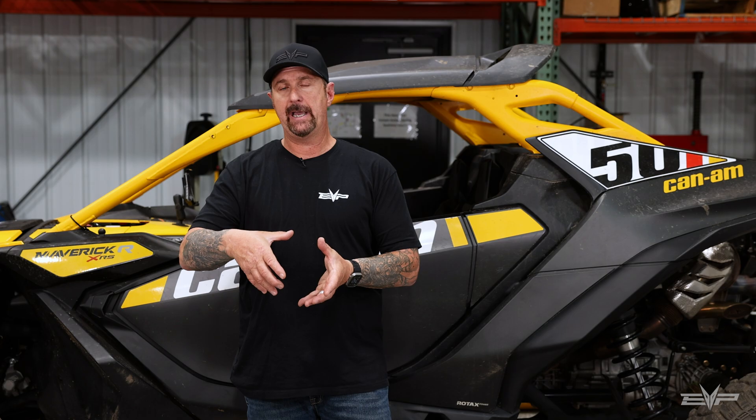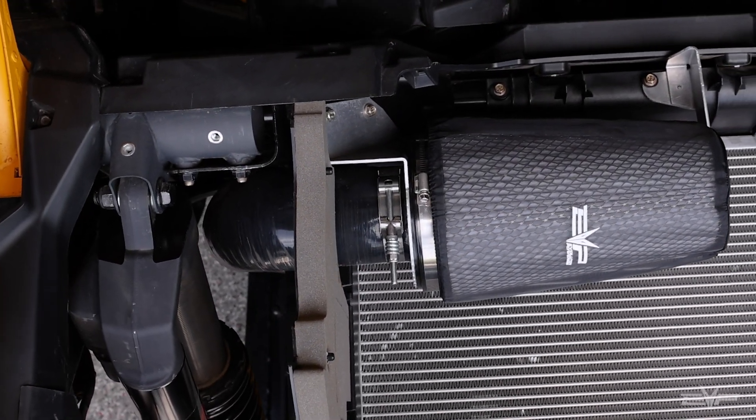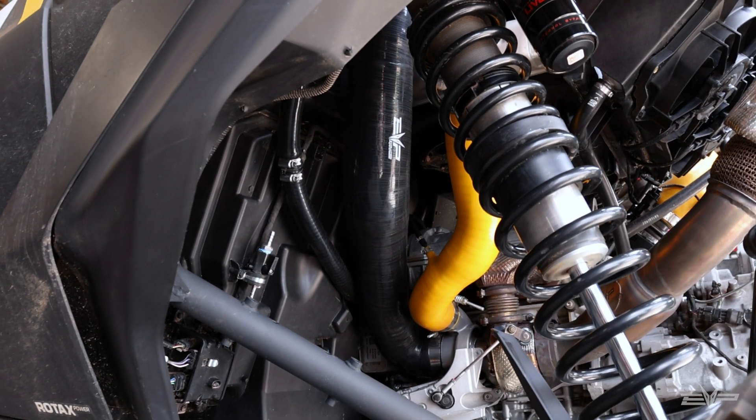The last thing — and this is probably the most important — is that we designed it with a very large inlet that comes out of the filter and into our venturi, which gradually necks down from that diameter to the inlet of the turbocharger. What that does is straighten out and smooth the air entering the turbo, making the turbo more efficient.